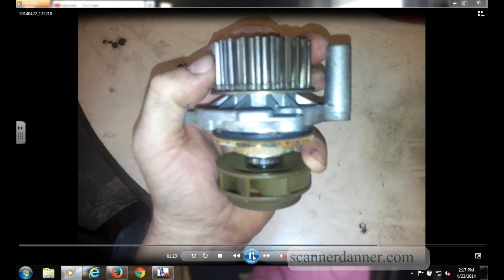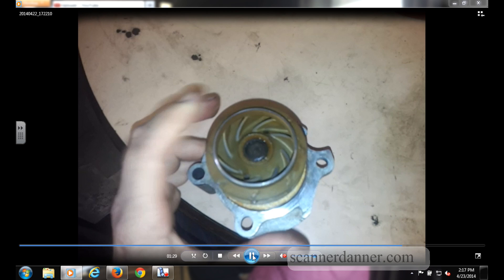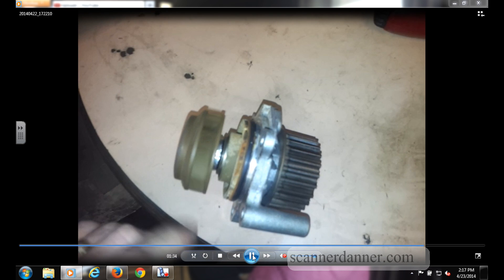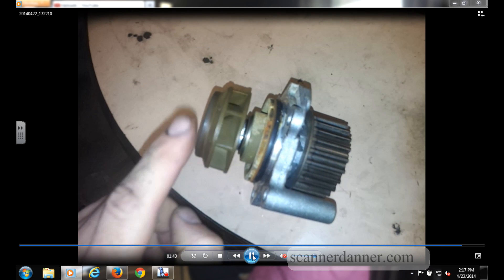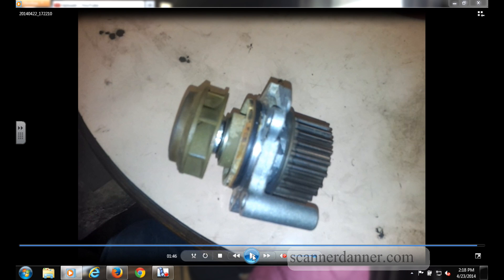Just to back up — the original video, the cooling fan video, is a valid test for the fan circuit and that's all it was. I did not address the thermo switch and I never checked the temperature of it, so I admitted that mistake before. There it is: broken water pump impeller. The impeller is not broken, but it is separated from the shaft and spinning freely. This was a metal one, not a plastic one. So it looks like the metal one's not the fix — some of you were insinuating the metal one's better. Well, that's a metal one and it's also bad.